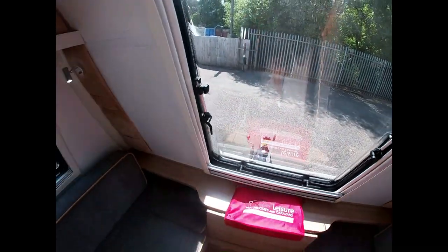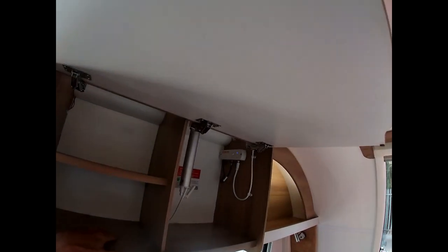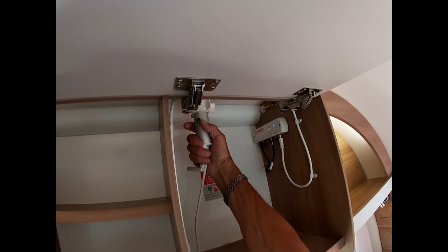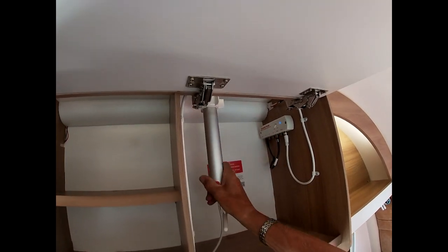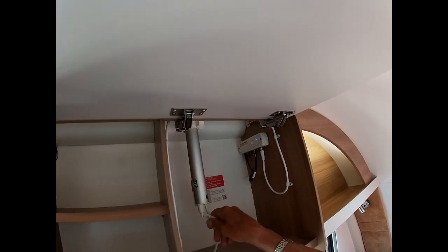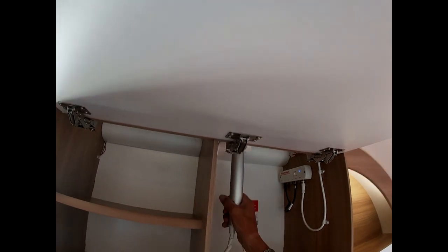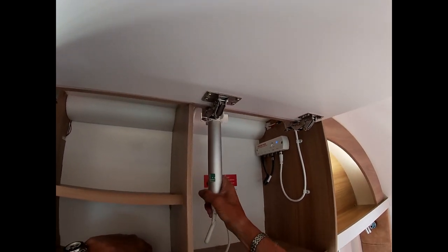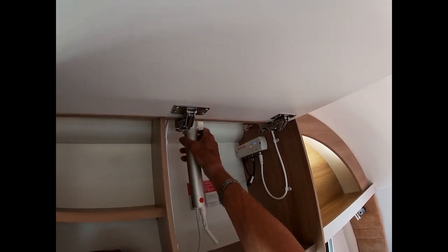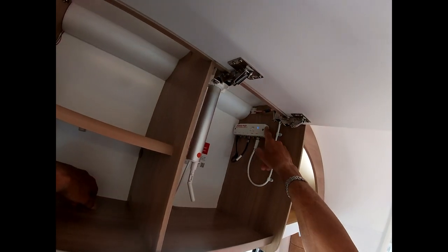Okay, and you'll find that on the front seat of the van when you come to collect your van. We've got all our overhead lockers, so we can open that. Inside this one, we've got a TV aerial. That TV aerial is directional. I can raise it, lower it, direct it. I can also alter the plane of the dish on the top by turning the handle, and that indicates what position it's at. I'm making sure that it's in the green, at the horizontal position like so. When we travel, I'm making sure that's facing forwards with a red dot inboard and just a little click off on the side. From that aerial it comes down and round into our booster.